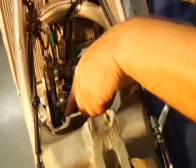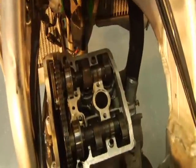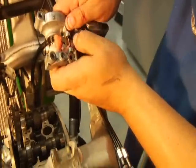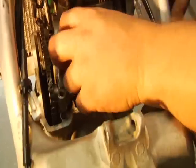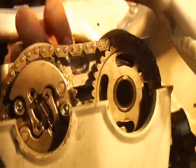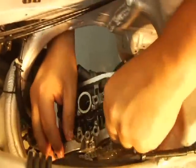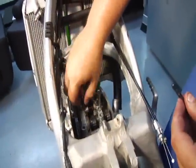Again, my dowels are in. Good to put them all into the cylinder head before you put the cam caps on. And a Kawasaki, as we spoke about in the intro, has the oil passage lines running through it, and it's best to install it all as one set. So simply push them together like so and drop them in together onto the cams. Be careful when you're doing this. You got the clips, you got the oil lines, you got the dowels. Make sure everything is lined up. Okay, the cam caps have gone on, and now put the cam bolts back in.